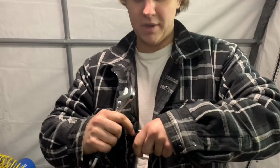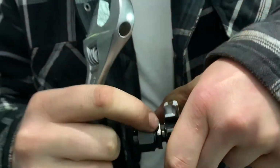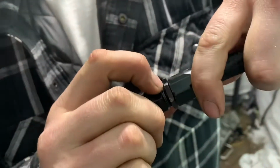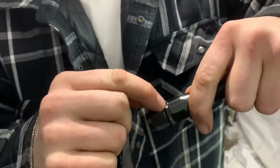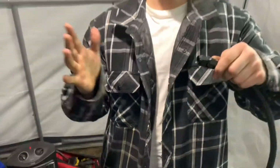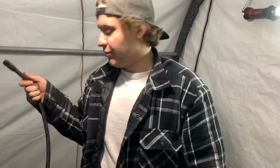I've had it with my return line on my turbo. It did not butt up these two sections here, from here to here. It was still open, but I could not tighten it anymore, and it never leaked. But all my other fuel lines and stuff, they've all been touching both ends of the fitting. I'll show you guys that in a minute when they're actually touching together. Well, this is a finalized AN fitting on the actual AN line itself. So this is what I meant by the normal crescent wrenches, these steel wrenches. They scratch up the line. And yeah, there's what I mean by a full butted together connection. So that ain't coming off, and it's ready to go onto the regulator or the fuel rail.